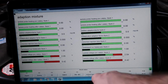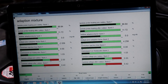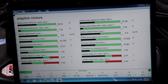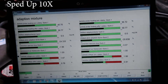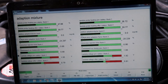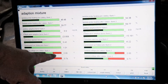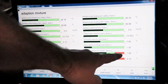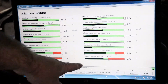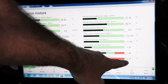I'm going to give it a first start with the new sensor — pay attention to these values. This is what you want to look for with healthy O2 sensors: they should be running similar. Bank 1 and Bank 2 should be targeting a similar amount of air and fuel, so they should be very close. It's 2 and 2, and the downstreams are very similar as well. These upstream sensors are wideband, going between 0 and 5 volts; the downstream ones are narrowband, going between 0 and 1 volt.